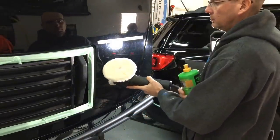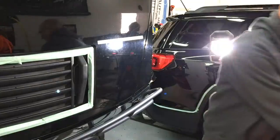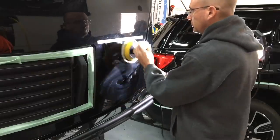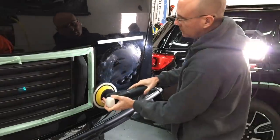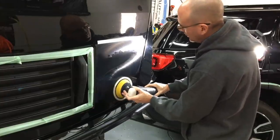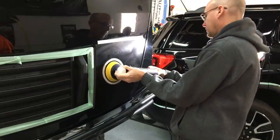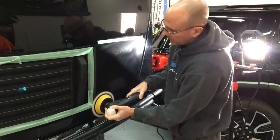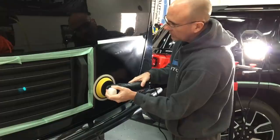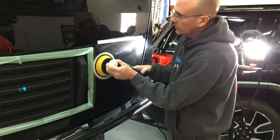I took care of the roof beforehand — a lot of acreage up there and just impossible for me to get footage for you. Luckily for us, the H2 here has a hood that flips forward so I can get a great angle and show you everything on it. We have staining and scratching — this hood is a mess, but we will turn it around. I have masking tape there for contrast for a 50/50 comparison. I'm going to get out my trusty 3D ACA 500, the rotary, and a Lake Country Low Lint Lamb's Wool pre-washed pad.